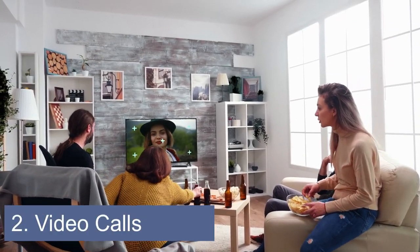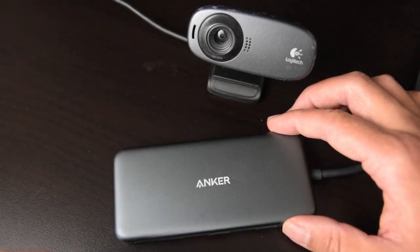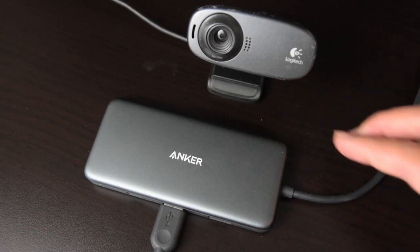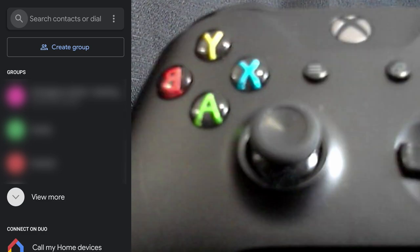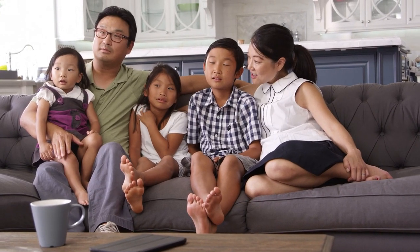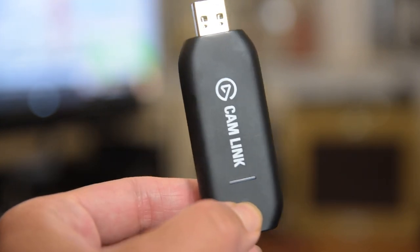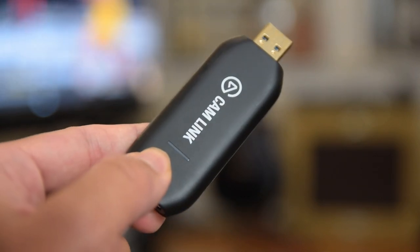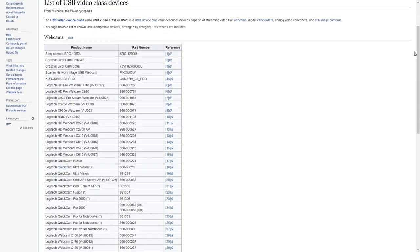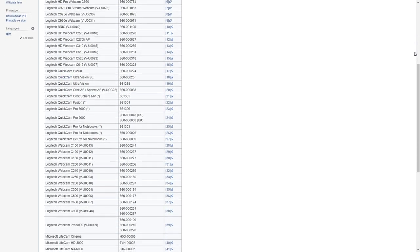The second functionality upgrade is if you want to use your TV to make and take internet video calls. You can connect a UVC webcam to the hub and install Google Duo. Duo will automatically detect the webcam, and you can start making and taking Duo calls. Having a webcam attached to your TV makes it easier for multiple people in the same room to participate in video calls. If you also have a UVC HDMI capture card, you can even use a DSLR for your Duo calls. I'll provide a link in the description for a list of UVC webcams.